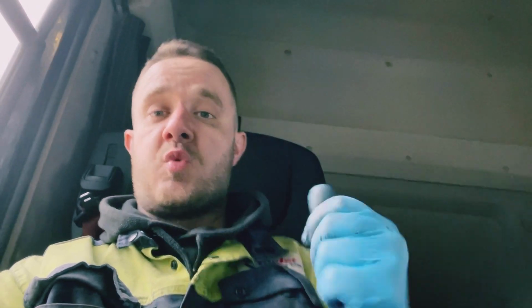So I'd like to thank everyone for watching. I hope you enjoyed this second part. It's quite a bit of time lapse in there, but it took hours to clean that DPF. The one thing I will say works: if you can prise it out a little bit and get that big bar and then twist it, if there's any AdBlue stuck in behind that, it will break it all off. So that always works a treat.